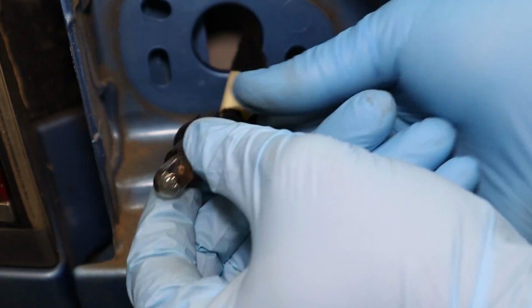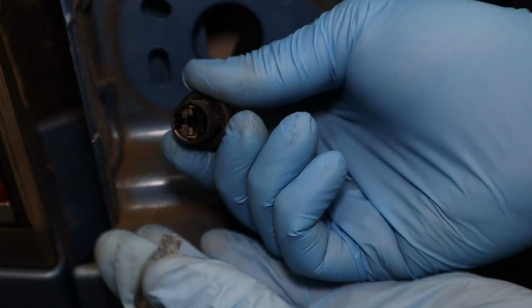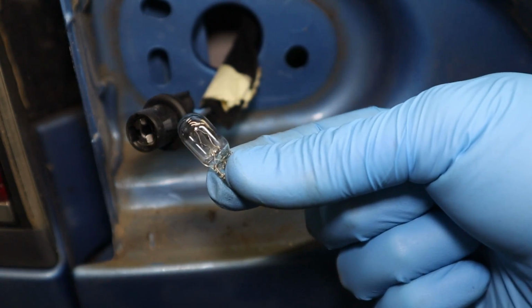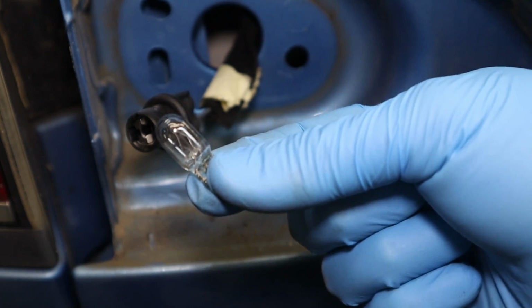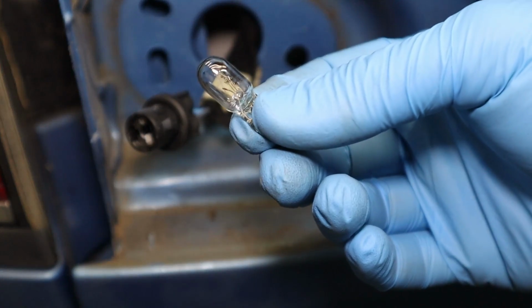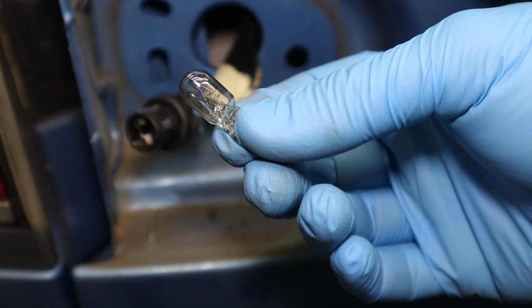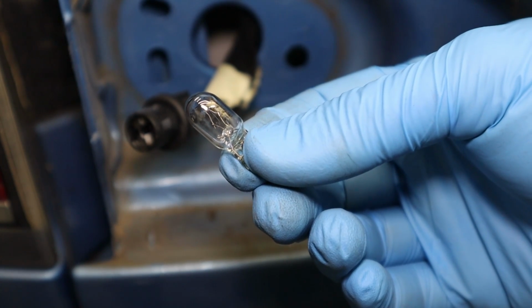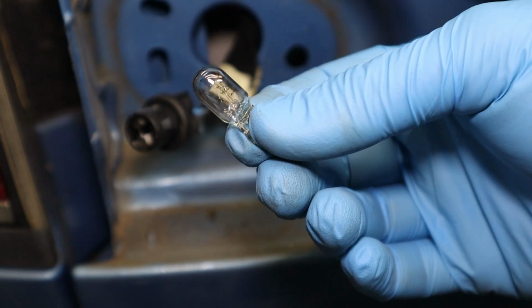Hold the bulb holder, not the wires from the back, and then this bulb just simply pulls out like that. So these bulbs are W5W, that's what you're going to want to replace these. I'll leave a link to some in the description to the video. And do not handle these bulbs with your bare fingers. Oils, hand creams, things like that on your fingers can create hot spots on the glass, and that will cause the bulb to prematurely fail. Either wear gloves, as I am here, or use a piece of tissue to handle it.